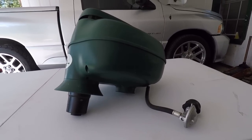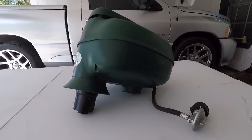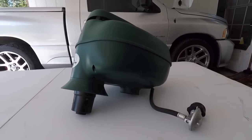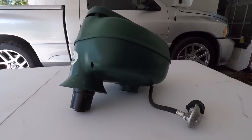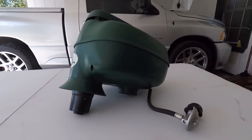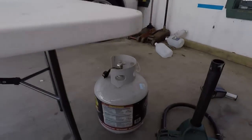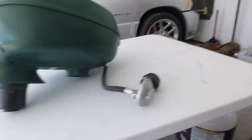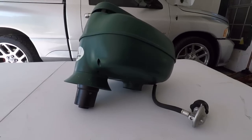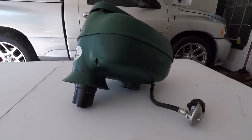It ran really well for the first nine months, about a year ago. I got through November, set it up, cleaned it, did what it was supposed to do, and let it sit. When I tried to fire it back up in February of this year it wouldn't start - the fan would come on, then it would trip out and you'd get the little blinky light. It was still under warranty so I called the company. They suggested trying to start it with the bottle valve only turned to about 30 to 40 percent open on a standard 20-pound propane tank. I did that, and sure enough it fired up first time. I went through three or four more bottles and it was fine, but this last time it tripped mid-tank. I gave it a kick and it restarted.